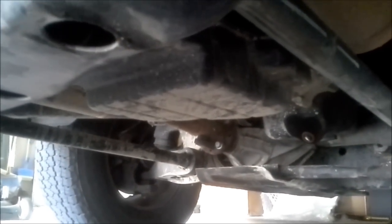Today we're going to do the transmission fluid in the Dodge Rams — the 545 or 45RFE transmissions. Probably the most neglected thing on a vehicle, besides the differentials, is people not changing the oil enough in the transmissions. Don't forget your transfer case — these two transfer cases use the same fluid as the transmission. On these, it's ATF Plus 4. That's what you want to use, nothing else — ATF Plus 4.